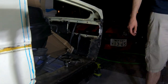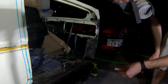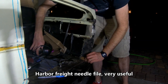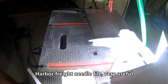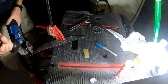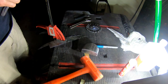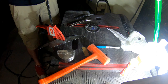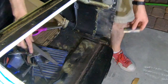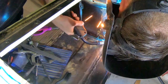In the next section I focus on cleaning up all the areas that I know I'll be welding on when I finally get the fender back on the car. There is a small piece that I am replacing on this back panel — it was cut out of the old rear quarter, which wasn't in terrible shape overall; it was just at the bottom where all the rust was persistent. You see me making the cardboard template there. Once I cut the piece out, I used a hammer, dolly, and pliers to shape it to the appropriate shape, because there was a sort of half-moon curve to it. After that I used a combination of files to do the last small amount of material removal so that the part would fit into the car correctly.